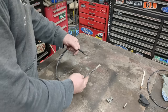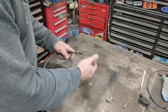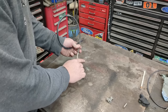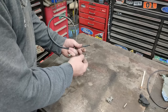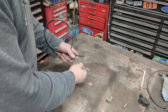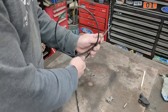So let's make one — making new cables is pretty easy, there's really not much to it. You've got your sheath, your inner cable, and sometimes they have custom ferrules and custom ends on them. Then you have your little retaining nub — this one has little cylinders. You can make balls, you can make the little S-curve — but let's make an entire cable from scratch.